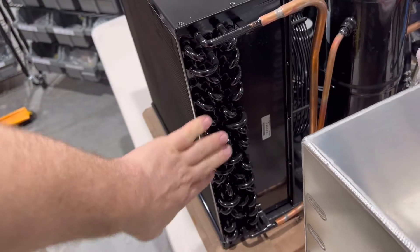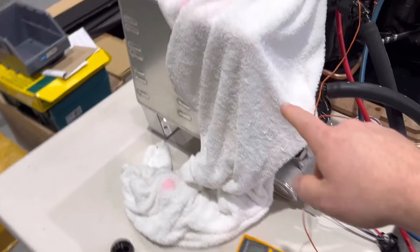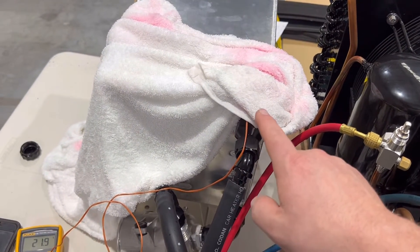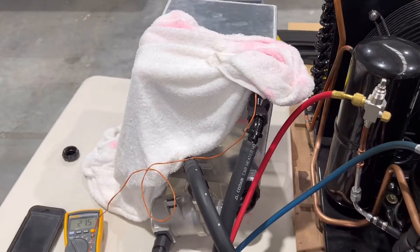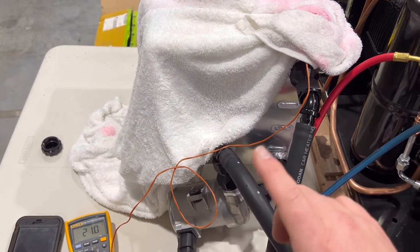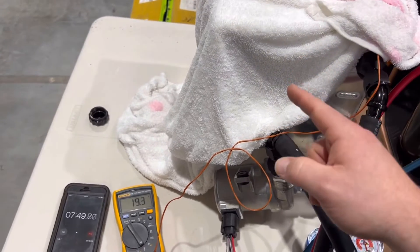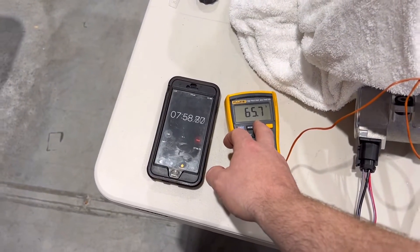What's also cool on this particular unit — just like our Stage 2 kit — it's got dual AC condensers, splitting off into both, which eliminates the most amount of heat. These are baffled tanks, really cool baffled tanks. Essentially we've got 7 baffle layers in there, so when you go wide open throttle, your returning hot fluid goes in the top on one side and can't mix with the cold fluid coming out the bottom. Based on your intercooler pump flow rate, if you set it up seriously, you'll have a minute or two's worth of fluid volume. Essentially that hot fluid can't mix with the cold fluid coming out the bottom, so you can say that from the start line to the finish line you've got the exact same temperature entering that intercooler for the entire race. If you put 20 liters, 5 gallons of fluid in your freezer and left it for 8 minutes, it obviously would not drop to that sort of temperature.